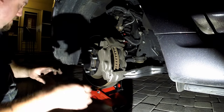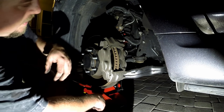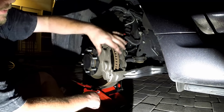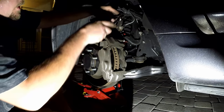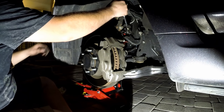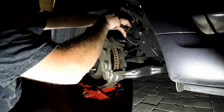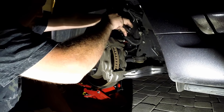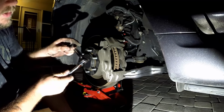So you just want to make sure that the prong goes back on the right side. That one comes out. Now, since we are doing not just brakes but rotors also, we need to go ahead and pull the rest of the caliper off. We are going to use our 12mm on this little bolt up here — sorry, it is 12mm, not 13mm as I said at the beginning of the video.